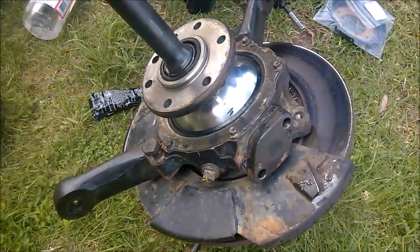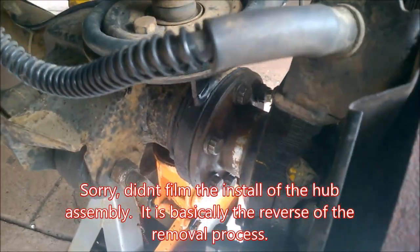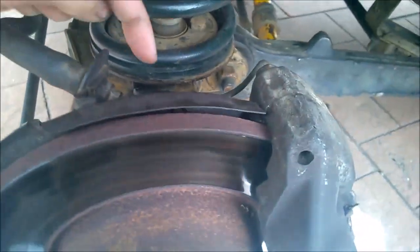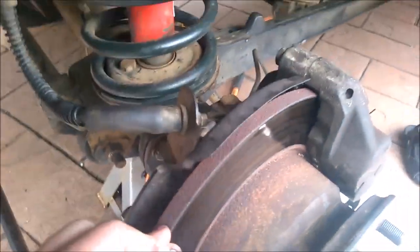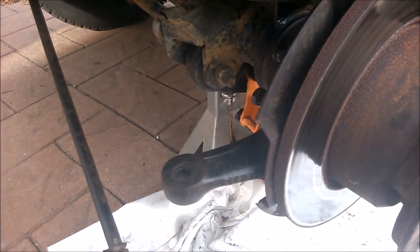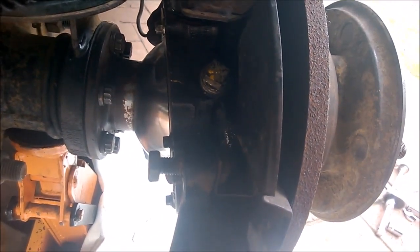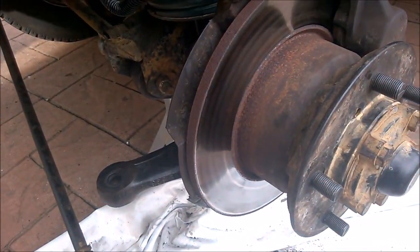So Pete and I finished putting in the bolts on the top and on the brake caliper. I can't quite remember whether I've said — you actually do have to take these two bolts out and the caliper out because you've got to slide the entire axle out with the assembly, as you saw in the video. So I'm going to put these back in, front and back, and after that it's going to be filling it up with gear oil to the level, put the tire back in, and that should be it.